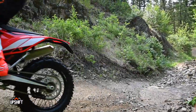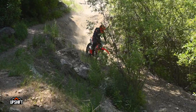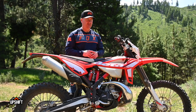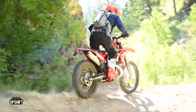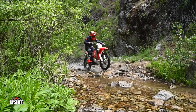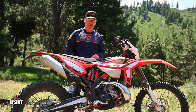Another big thing: this is an off-road bike and there's trees and stuff you hit. I would undoubtedly grab a set of hand guards on this thing right away — I hit a few bushes and branches that pulled the clutch and brake lever. If it's technical, you've got to have hand guards; it's just part of off-road riding. Also, Betas are kind of notorious for seats. This thing resembles a two-by-six that's been shaped and bolted to the bike because it literally transfers everything right into your butt — the seat is super hard. I would hit up Seat Concepts or somebody and get a softer seat that comes out a little past the riding position and makes it more comfortable. The cool thing about Betas is you just push one button, the seat comes off, and you get to your two-stroke oil fill bottle.